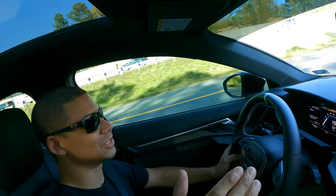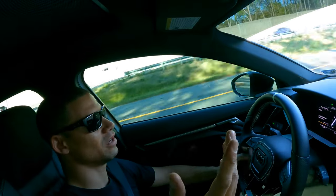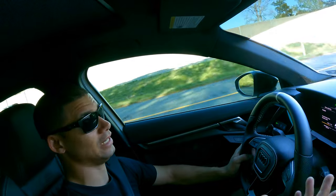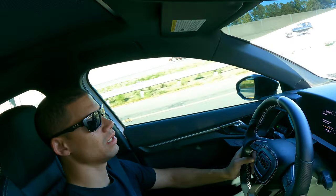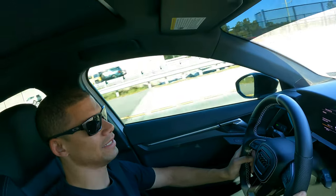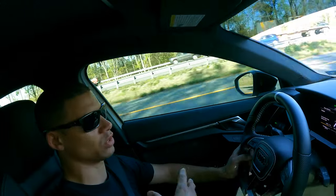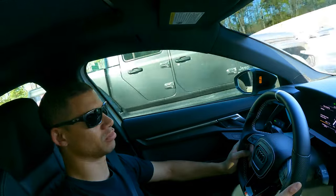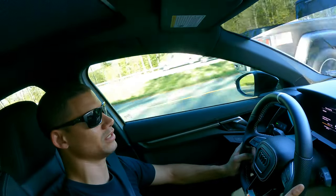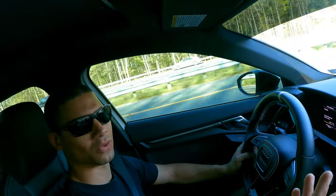Seriously, this thing's legit. I just wish I could get a better run for you guys. I would think that these tires would be better. I mean, they're really there for autocross, not really so much for drag racing. I guess I need to really try and borrow a set of radials or something. I don't know if I'm going to be able to get into the tens with the tires spinning like this. I decided to try some daytime runs when the road would be warmer, but it's putting so much torque down that it wants to spin them just enough. I'm getting better 60 foots at night when it's colder than when it is hotter.